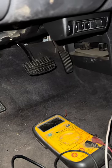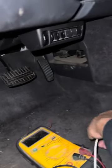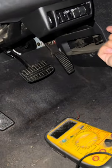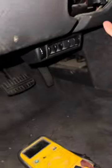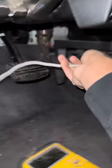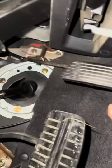Connecting an OBD2 will not get you anywhere. You have to ground pin number one on the port so that your check engine light starts flashing, otherwise your check engine light just stays on but it doesn't flash a code. So I'm going to show you how to do it. You need a paper clip and a wire, that's all you really need.